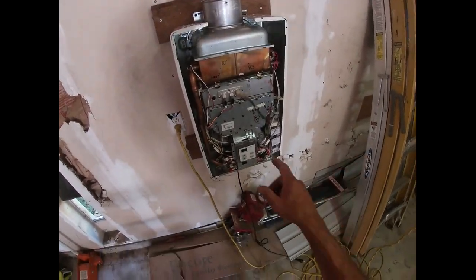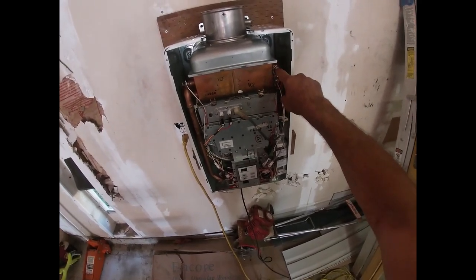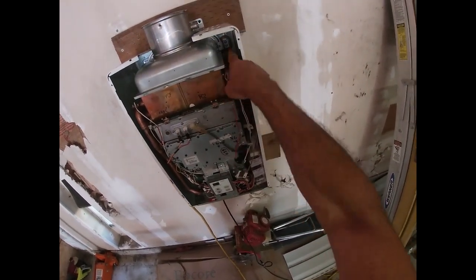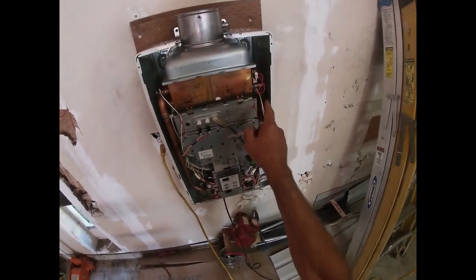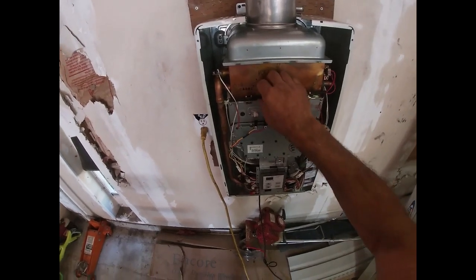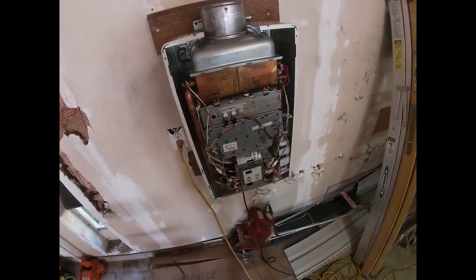Here's your thermal fuse — this thing here is the beginning of your thermal fuse, and I believe this will open if it gets too hot. If you follow these wires, one goes that way towards the back through a white sleeve, and one goes this way through a black sleeve. The white sleeve wraps around the unit and comes back here — they meet right here in this sleeve. There are fuses in there; they look like resistors, and there's a bunch of them.